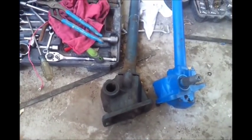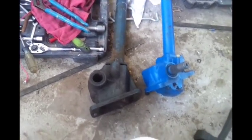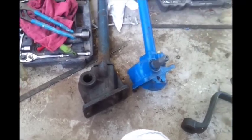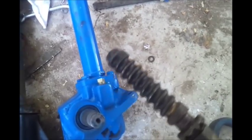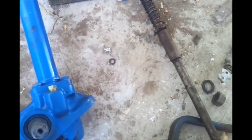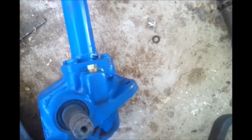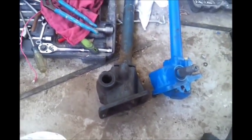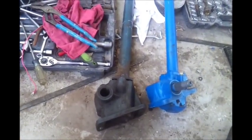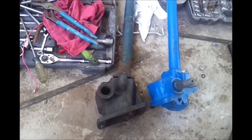I have a tractor here, it's a 240-295 DT, and the steering box came apart. This is real common — this gear here is all worn out and it slides into this thing here with all these ball bearings. It's basically destroyed. I checked for the parts and people say they're available, but the more I investigate the more they're not, so I'm making a quick video to show you guys how to fix this.